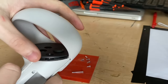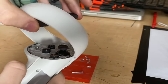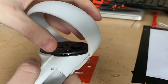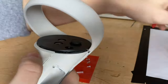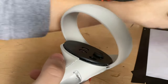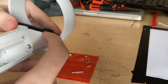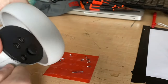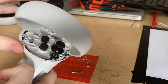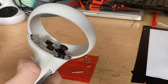Next you want to take off the black top cover. It's held in place around the edges with some adhesive. Lucky for us there are no ribbon cables in the way like on the touch controllers. What you really have to do is blow a hairdryer on it and then take a little plastic spatula — you don't want to scratch anything with metal — and drag it around the edges of the cover. Remove all that tape slowly and carefully; it did take me a little while.